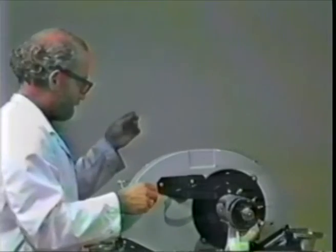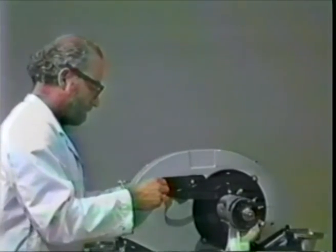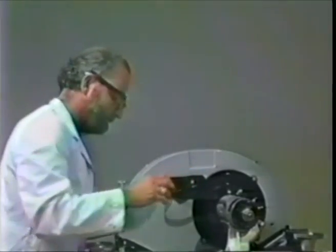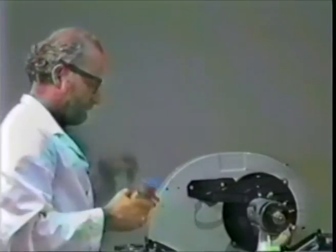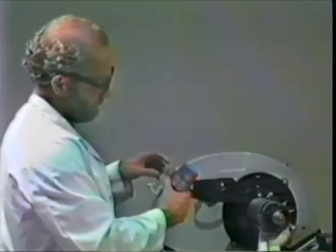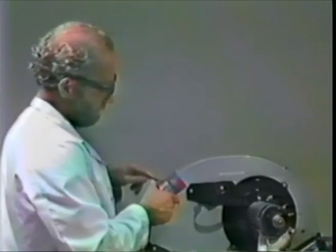This time you just need a regular 6mm washer and a nut. Don't tighten it down yet, just put it on loosely, because we have to put the coil on. Get out your Bosch 6 or 12 volt coil, depending on what voltage your engine is. This is the ugly one I don't like very much. It's got a cutout here and a cutout here, but that's the way they come anymore. The old style bracket just had a hole there and a hole there. It was much better. The only advantage of this is you can get this bracket on loosely.